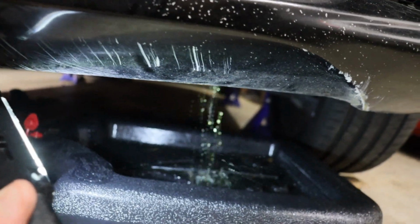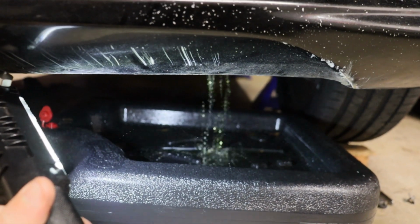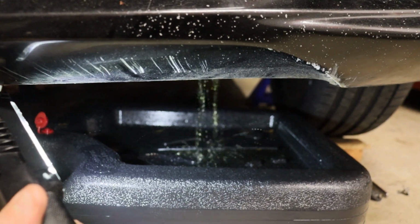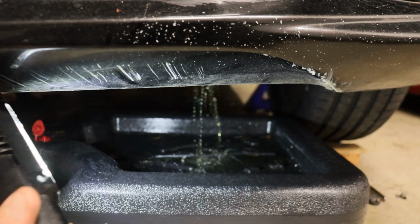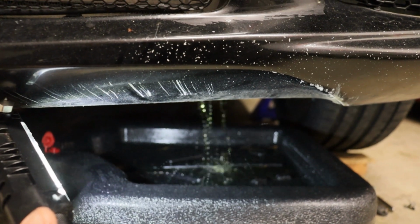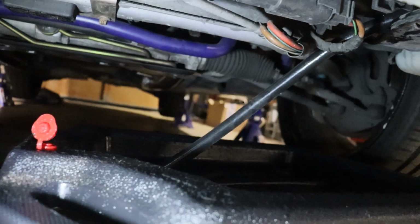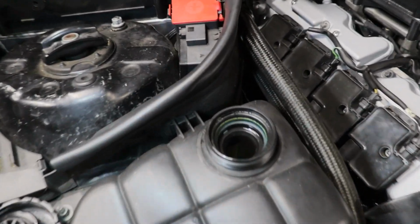Alright guys, petcock undone, and yeah, like I saw, this is probably just generic coolant. So now I'm kind of wishing I would have got Pre-Stone for it, but oh well. Let this drain out. Alright guys, much better method. Forgot they have the little drain vent right there, so just put a hose on it. It's going straight into the pan now. A lot less messy.